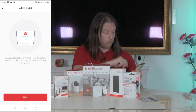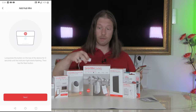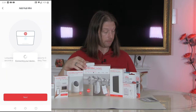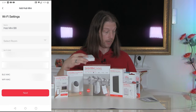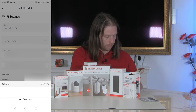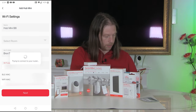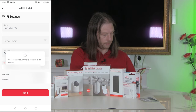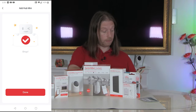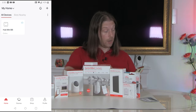We'll click on the mini. We need to take the SwitchBot hub and, using this button, press for three seconds until the light starts blinking rapidly, then click next. It's now slowed down again and it has found it. We can now say where we're going to store this — we'll put our Wi-Fi ID in and connect. That's all gone through — really simple, easy setup. You can now see the light has gone solid white, so click done. It's online and connected to the cloud.